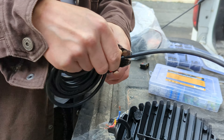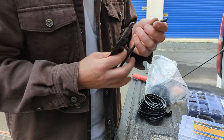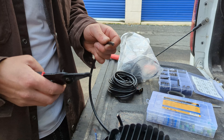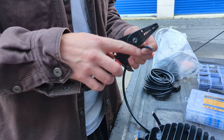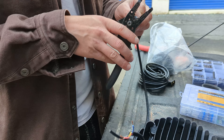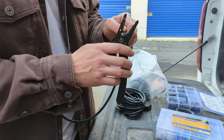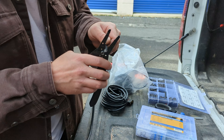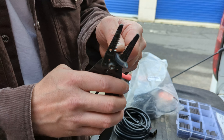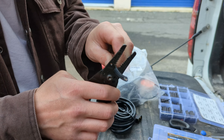I'm going to cut this — it really wasn't that much wire we needed. Once we splice one end of this to the light, I'm going to make a connector out of the other end so the light can be removed if needed. If you want, you can just cut off the connectors and use those shrink wrap crimp connectors — it's not a problem, it'll hold.